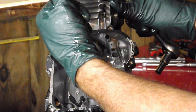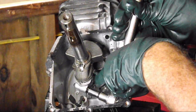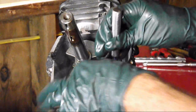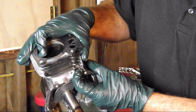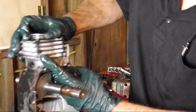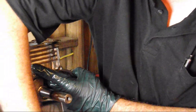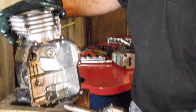By rotating the crankshaft, I can get my ratchet in there. It's two 8-millimeter bolts, and I've already put my witness mark on it. Just remove it and then we'll remove our crankshaft. Pushing up on our connecting rod, I'm pushing out our piston — here it comes. And now our crankshaft comes right out.